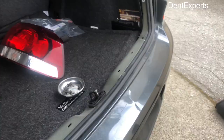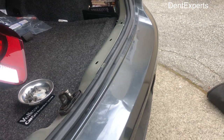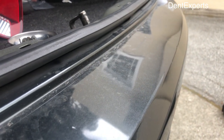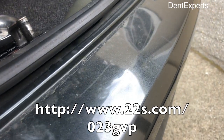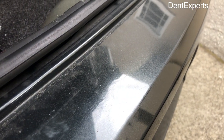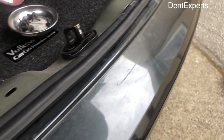On to the next car. I also had to fix this bumper because it was all part of the same accident, and I wouldn't have gotten the job on the trunk lid if I didn't do this bumper. I teach that in the private group — you'll see the link. Basically I heat up the bumper and press down that hump right there and push out that crease. It's possible to do with polyurethane and I'll show you how. Thanks for watching.